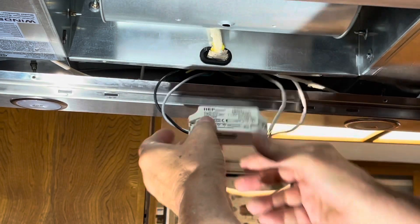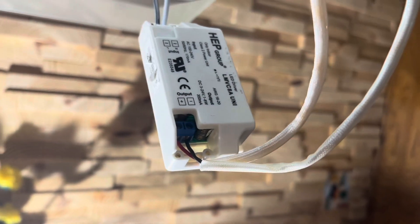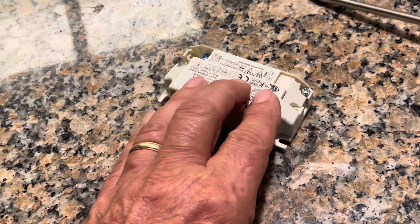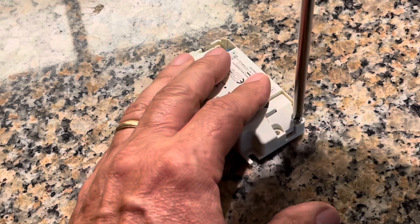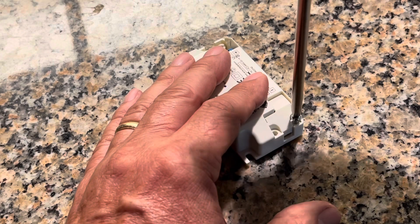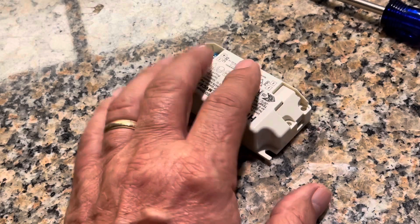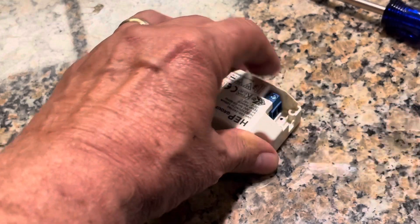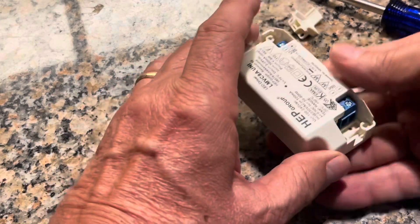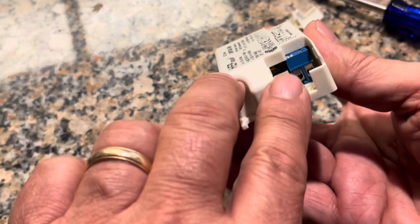Once you get it out, we can begin to work on it. You order a replacement LED driver from Windstar directly, and you prepare it by taking off the cover screws and removing the plastic cover piece, which just pops up a little bit if you pry it. Inside there's a terminal block that has two little set screws on top and two openings to insert the wire into.